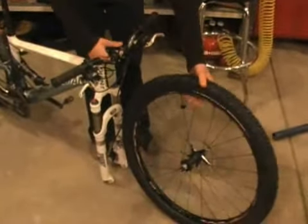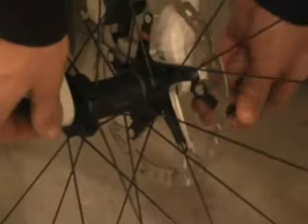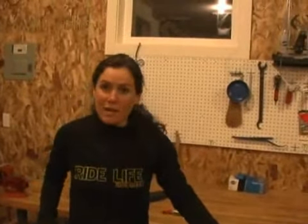Now you can put it back onto the bike. Slide it in, screw down the nut — about 10 to 12 turns like before. Sometimes you need to check the lever and see if it's tight enough; if it's too tight, just back off the bolts a little bit. And there you go — that's how to fix a flat. I recommend practicing this a few times before you go out on the road yourself, and just enjoy the ride.